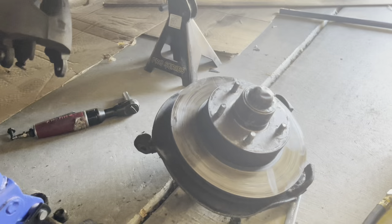Now we're going to take off the lower control arm. I'm not even going to mess with this without a breaker bar — 13/16 wrench, 13/16 socket with a big breaker bar, both sides. I actually found my ratcheting breaker bar, which is much easier. If you don't have one, it might be worth buying one. Got the bolts out — had to move the steering a little bit. Make sure that your tie rods are not digging into things on the ground so it doesn't knock your car off the jack stands. I'm going to pry and kick this thing out without trying to damage my headers any more than I already did. This side was actually very easy — I pulled it right out with no trouble, ten seconds max. The passenger side was harder, so I had to take a pry bar and stick it up in there and maneuver around and pull it out.